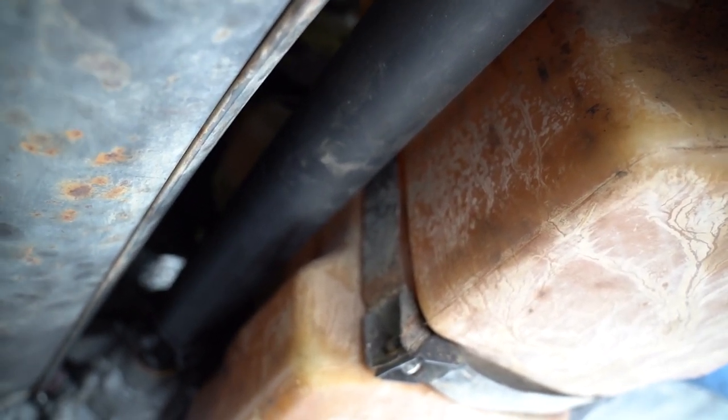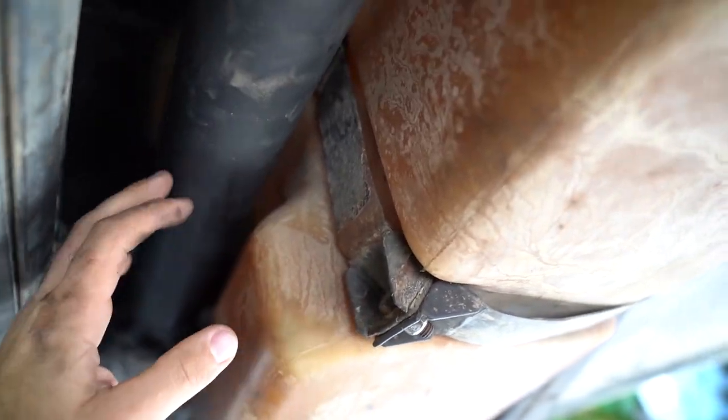The fuel tank drop-down was a confusing thing I wasn't sure how to do correctly — the straps, cutting them, lengthening them, buying straps. I couldn't really buy just the straps, and the kits were quite expensive. So I did it this way. The problem is: the rear driveshaft has a cutout in the tank — top and bottom — for the driveshaft, so it's got to stay exactly lined up with the shaft. The tank is attached to the body, so doing a 3-inch lift moves this into contact with the driveshaft. That would be terrible — you'd rub a hole through the tank; it'd be a disaster. So you have to lower the tank the same 3 inches you go up.